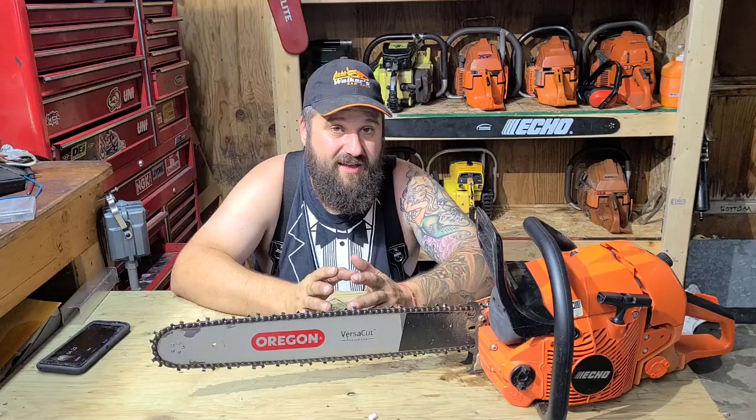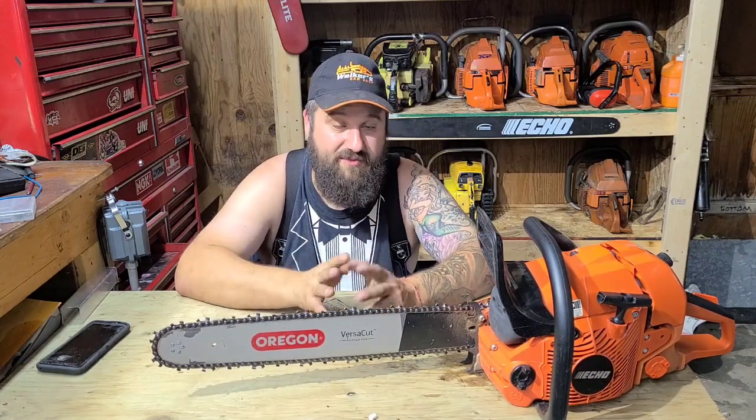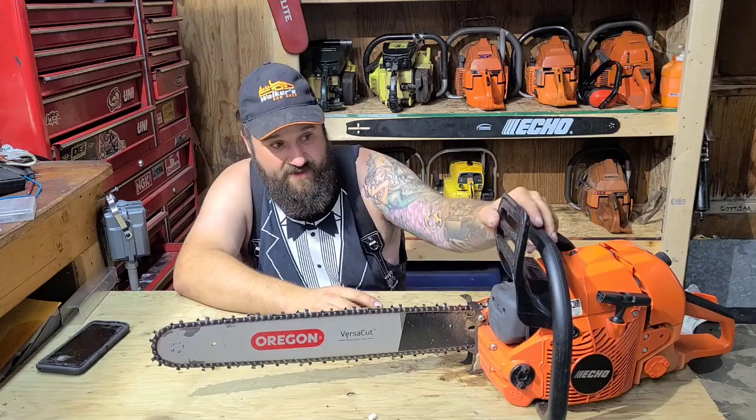I'll give you guys a little blurb at the end of this video, and you can watch a stock cut, or you can watch a cut with the carb and the coil, and then one with the carb, coil and the muffler. Now, what I'm seeing, comparing 562 to 590, this thing with these parts on it cuts as fast as a 562, believe it or not. This thing's averaging about 3.5 to 3.7 seconds in the cut. That's exactly where the 562 was cutting, on the same log with the same chain. So I'm pretty happy about that.